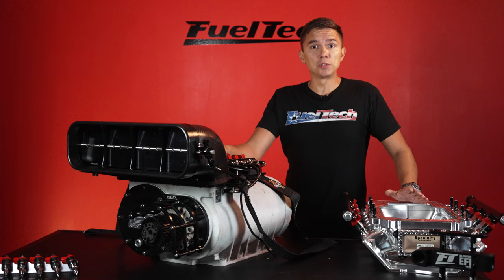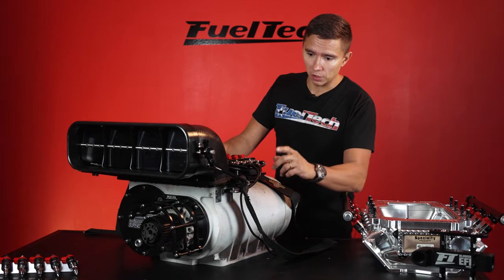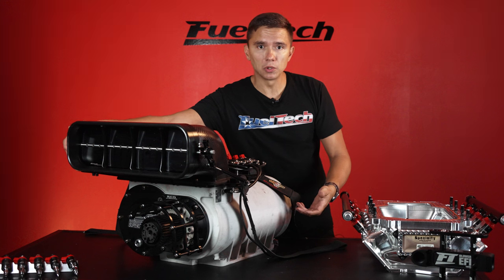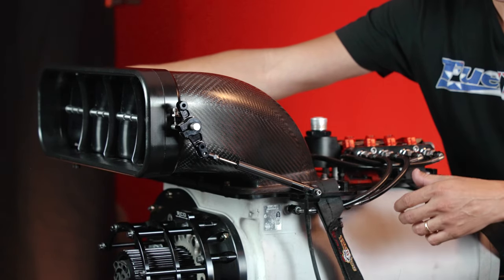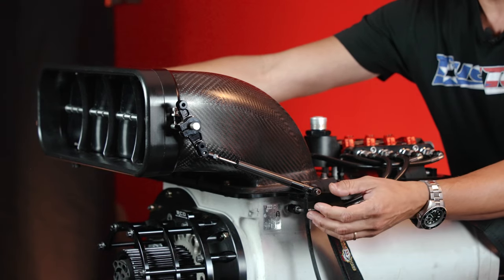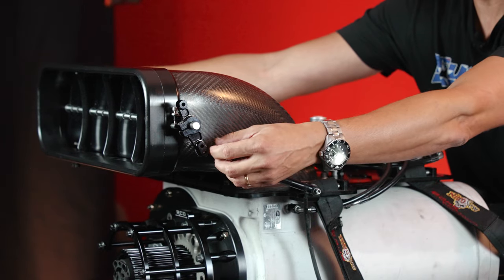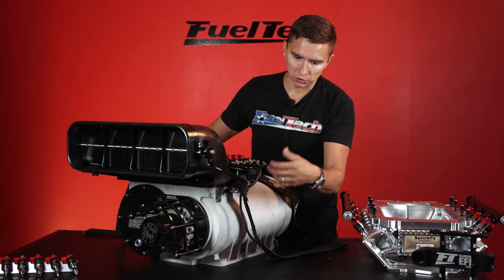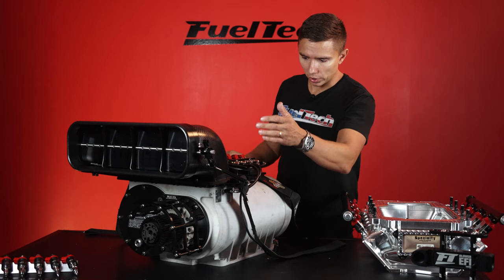With the car back in its stock position, here's a nice detail. This is usually used as a shock travel sensor, but on this particular blower we're using it as the TPS. Instead of using cheaper sensors straight on the shaft, we're using the assembly where you used to have a barrel valve for mechanical injection. We put a shock sensor that measures the opening of the blades — it's a good, reliable sensor and really easy to install on a blower like this.